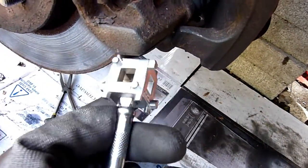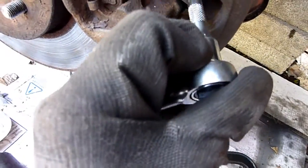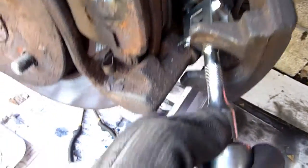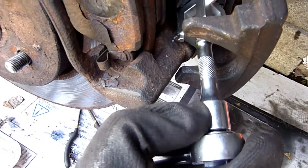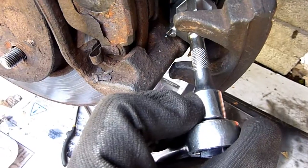Get this tool — the square fitting goes onto your ratchet set. Find the one that fits your piston like so; this is the one that fits mine. What you do is rotate it clockwise while pushing in — clockwise and push in. In this case the lugs, the holes, should end up roughly horizontal so it fits onto the brake pads.